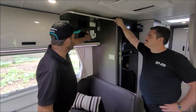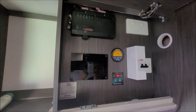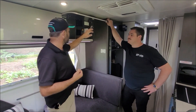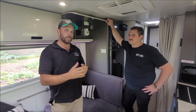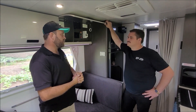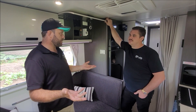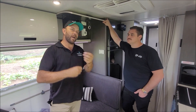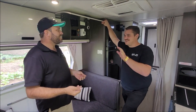This is the ePro Plus battery monitor, and at the moment we have a deficit of approximately 34.9 amps. Keeping in mind there is 720 watts of solar on the roof on this build, the net value being consumed right now with the air conditioning fully running is 35 amps. Had the solar not been connected, we'd see figures upwards of around 70 amps per hour. If we ran it for 10 hours, that's 350 amps of consumption — and with 400 amp hours of power, you can't simply plan to run it for 10 hours without a means to put that power back.